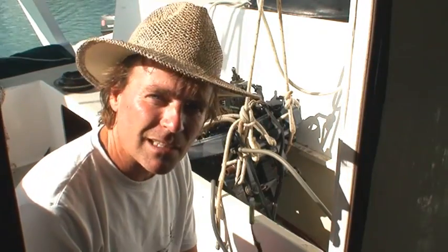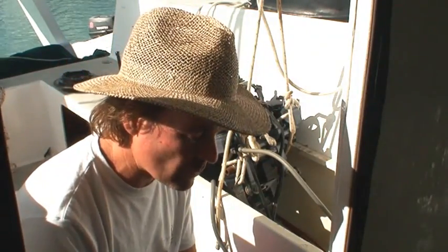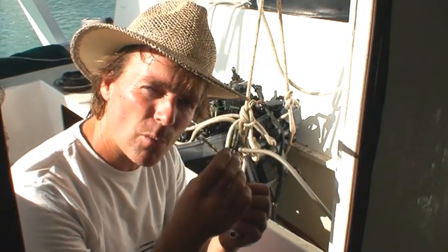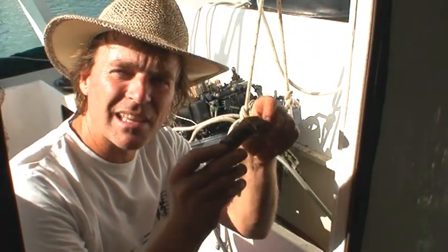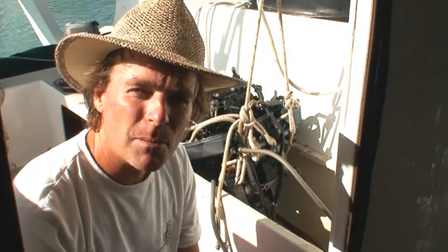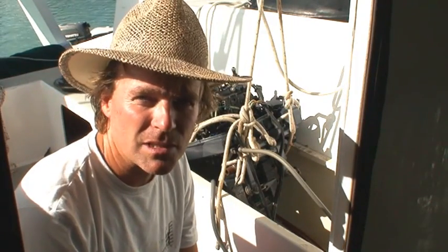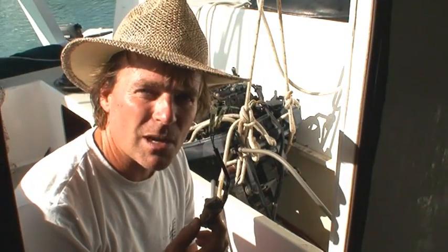I've been chasing this for a few days. Luckily I've got two of these engines, so I've swapped through all the electrics. The significant thing was there's a pair of brown and blue wires that appear from underneath the flywheel, and these actually come from a charge coil — this little fella here. You can't really pick that up, but this little charge coil is the thing that generates the power that drives the CDI, the little computer device that fires the spark for these engines and does a bit of engine management. I'm a bit suspicious of this little one I've pulled out.